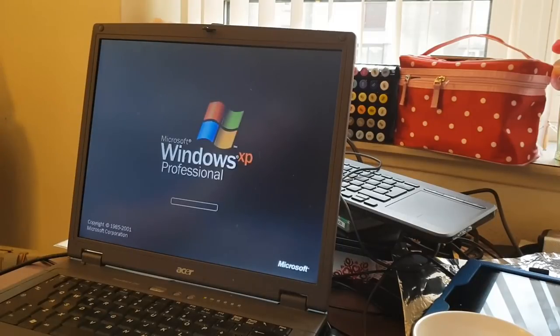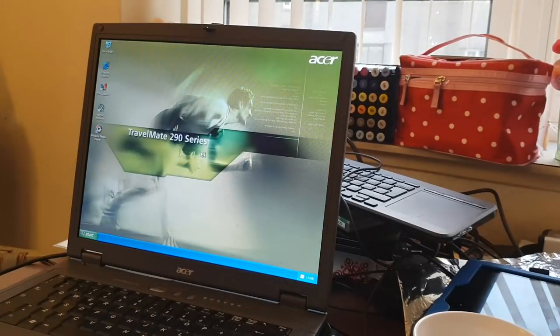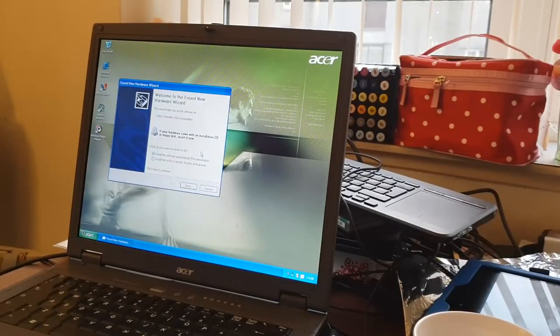Yes, folks. Windows XP, obviously, for a lot of people, was the turning point from the 9x to NT platforms. So, as a result, some of the restore programs would install, format the hard drive, put the image on a FAT32 partition, and then convert it during the sysprep process. But I think as time has gone by, images are now on NTFS drives.